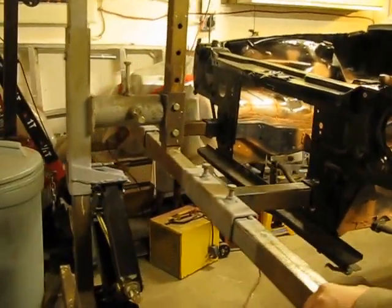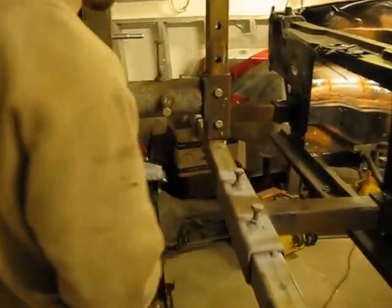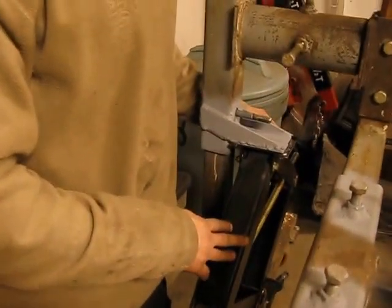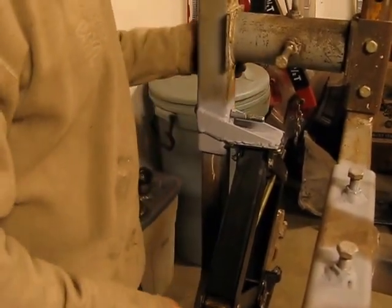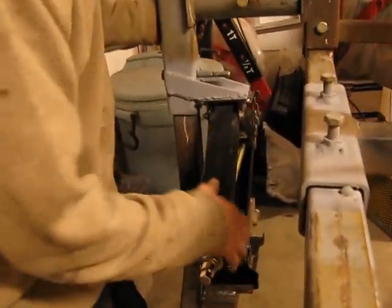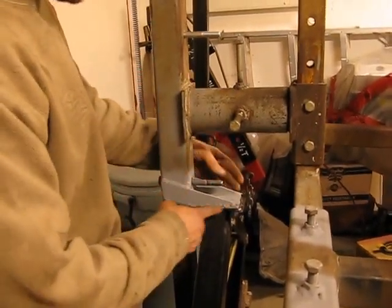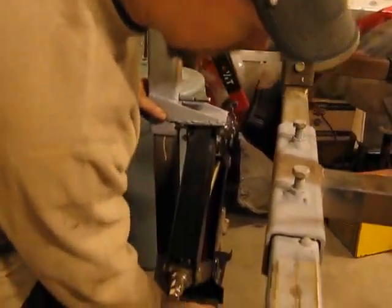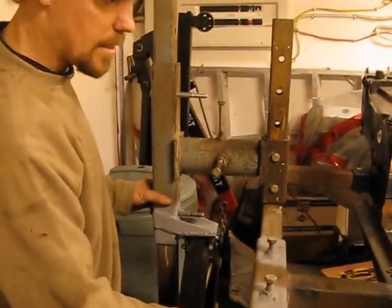This device came very plain Jane. It did not have the scissor jacks that I had purchased from Princess Auto — they were 5,000 pound scissor jacks, capable of lifting a motorhome type vehicle. What I did is I made plating underneath for the supports of the scissor jack, and then to lift this retaining shaft up, I made these connectors with 8-inch steel. This is all pretty much between 1/4-inch and 1/8-inch steel welded securely on these bars.